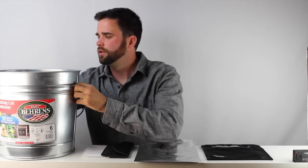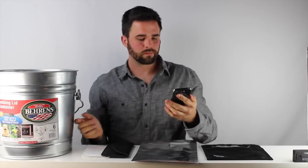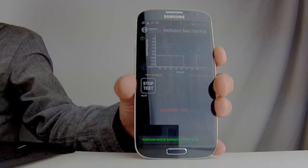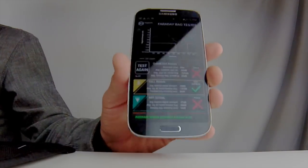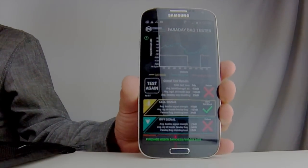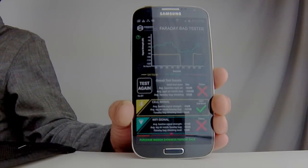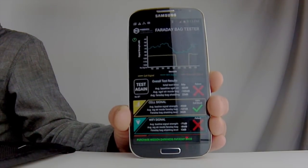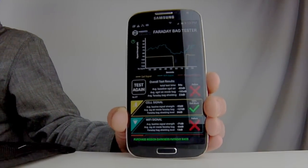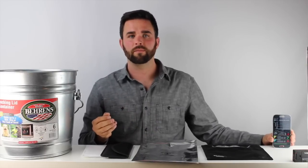It's been in here long enough, so we'll take it out, put the lid aside, bring the app out, and put it over here on our GoPro to check it out. I can see right away that it blocked cell signals but it did not block WiFi. WiFi was shielded at about 13 dB while cell signals were shielded at 34 dB — enough to block the cell, but the WiFi only dipped just a little bit. So this is not going to block all signals, especially in scenarios with higher-strength WiFi routers, Cisco routers and other higher-power ones like in an office or an airport.